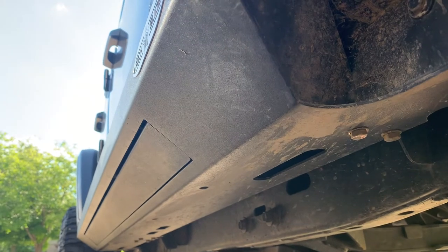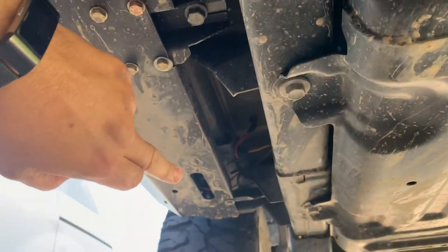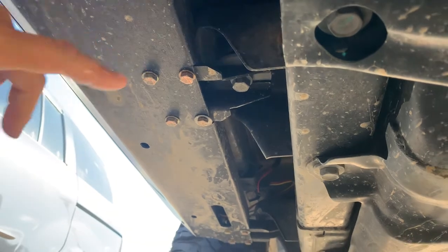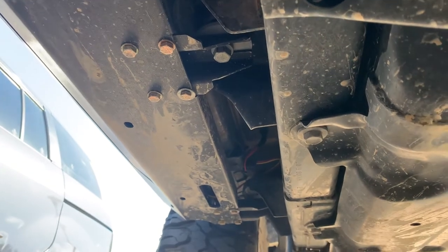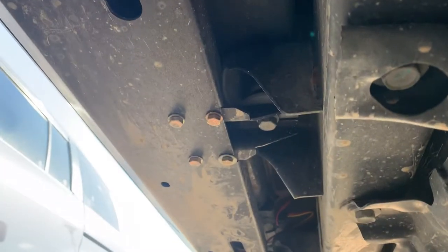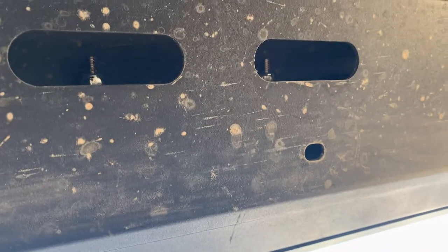So let's look at the install on these Rock Sliders. You have to take off the three body mounts — one in the back. Take those off slow. If you break those bolts, don't go at them with an impact. Each of these mounts gets a special bracket onto the slider. So these sliders mount in three spots on the body as well, up in these little pockets, and also in three spots into the pinch weld of the body. So there's quite a bit of strength there.